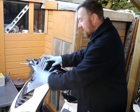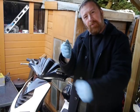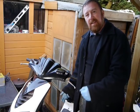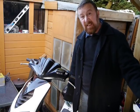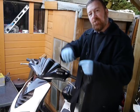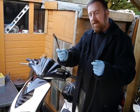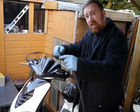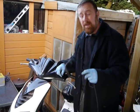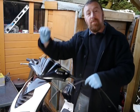But as I said, all these panels have got to come off to get the cable. Don't try and push the cable through a different way — cheat. I've seen some people literally just dangle the cable here because they couldn't be bothered to do it. It's not going to last; it looks tacky as hell. On a 125 motorbike, you often just have to take the seat and tank off, then trace the wire. Remember how it traces through and follow it. The reason is because the steering changes, and if you kept it tight, it would rev up and shut off again. That's an MOT failure, by the way, and can be very dangerous. Imagine on these peds — the fact that when you turn it, the revs go up and you fly off down the road. So make sure you get the right cable as well.